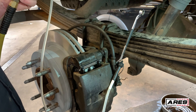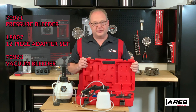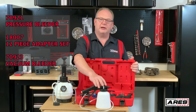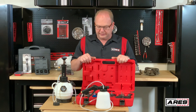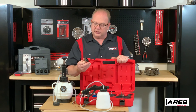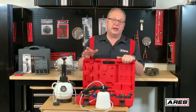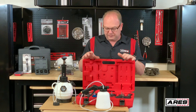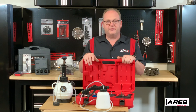So you've seen our 70921 brake bleeder, our 18007 master cylinder adapter kit, and our 70923 vacuum bleeder at work. With this combination of tools there's really not anything you can't take care of. Keep everything clean, use fresh fluid from a sealed container, get your caps on right, and make sure your adapters are tight so you're not getting brake fluid on the paint. Dispose of your fluids properly and responsibly. Thanks for watching — be safe out there, register your tools, join our club, and we'll see you next time.